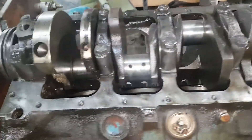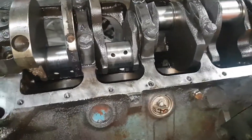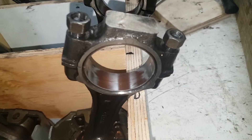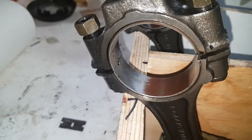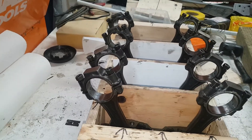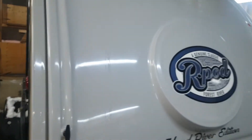The crank is good to go. Haven't had a chance to measure the bores yet — that's a more fussy job to do. Got the pistons all out. As you can see, the bearings are getting into the babbitt pretty good, and that's all eight of them. No surprise there, but a new set of bearings and pistons and it'll be good to go. This weekend gonna have something a little different to do.